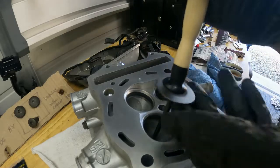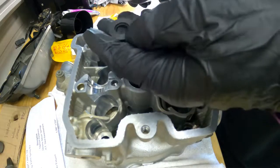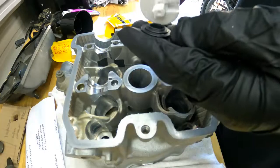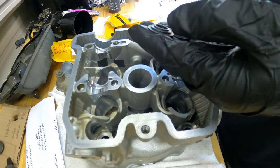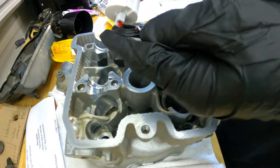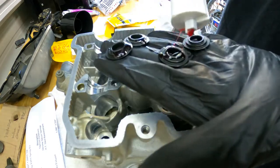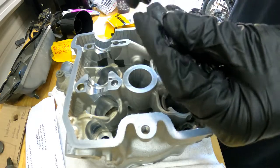I'm going to do the rest of these and then we'll keep moving on. Now I'm going to put these oil seals on. I'm going to put a little bit of Ultra Slick assembly lube on these washers — these base washers — drop them in, and then I'm going to put the oil seals on. Get some lube on there, get it all lubed up.